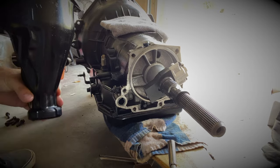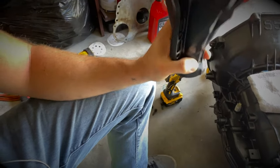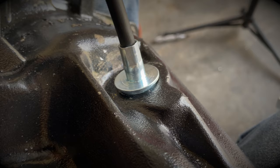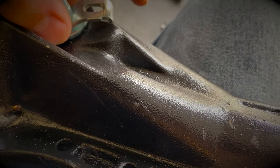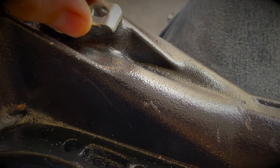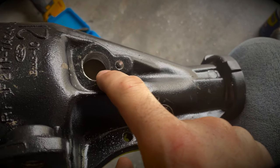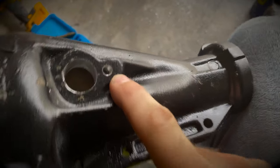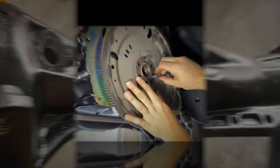We do have our gear. There's the provision — the speedo gear you can see on the inside, it does not go through all the way, so we're going to go ahead and drill that through. I got a 22-millimeter drill bit. I got the hole drilled for our speedometer cable. Now I'm going to mark the hole for our retainer. Looks like I'm also going to have to flatten out the edge here because the casing is larger than what this cable was made for, so I'll probably flatten out this tab. This is our final product — we now have the hole for the speedometer gear drilled and tapped for the retainer. So now we can bolt this back up to the transmission and get the transmission in the car.